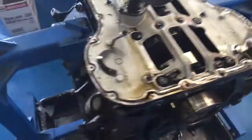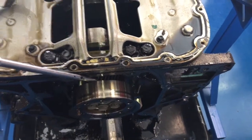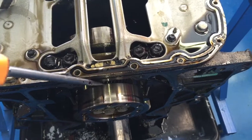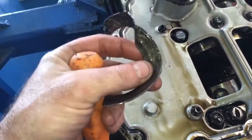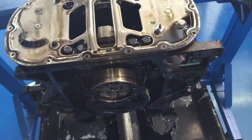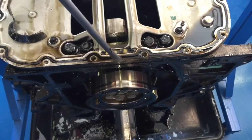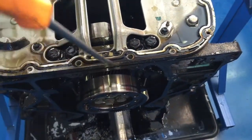Check this out — right here, watch the crank. That's good in-play that way. Now watch right here — did you see it? That's got like way too much crankshaft end-play. Look at that — that is a thrust bearing, main crankshaft thrust bearing. Holy crap. That means the crankshaft is probably trash — we'll see. I don't go lightly when it comes to this. See it moving — crankshaft end-play.